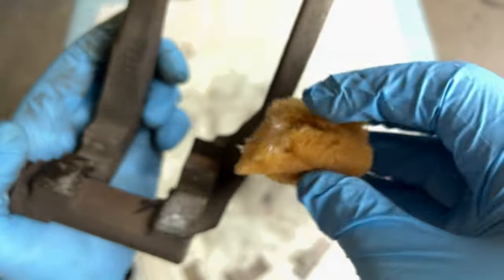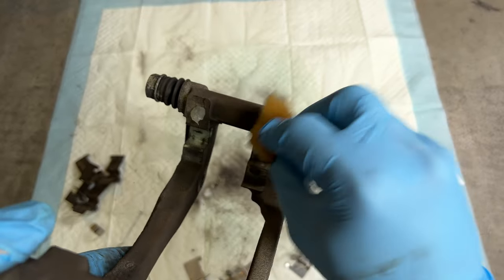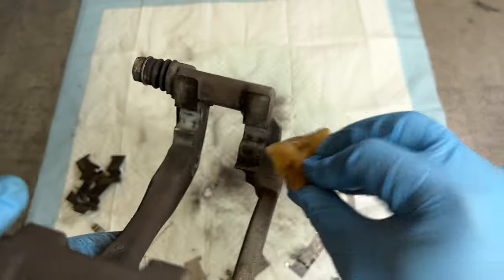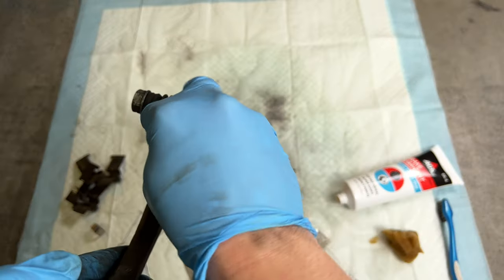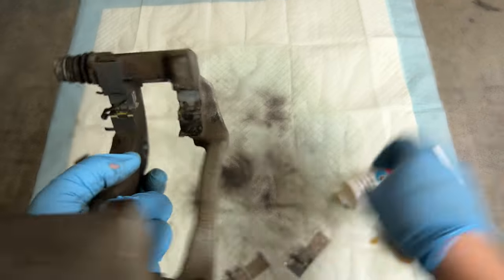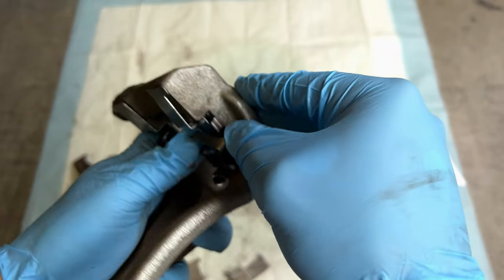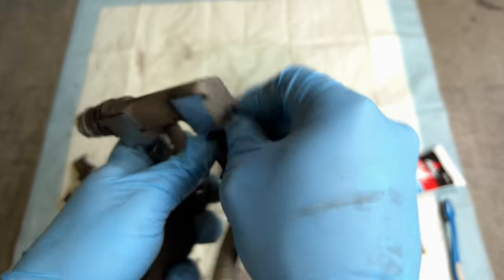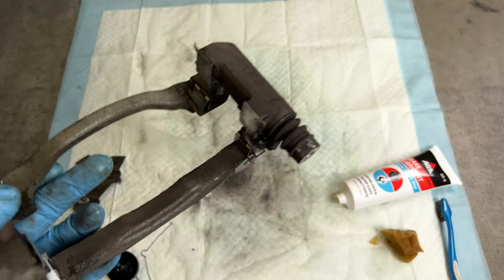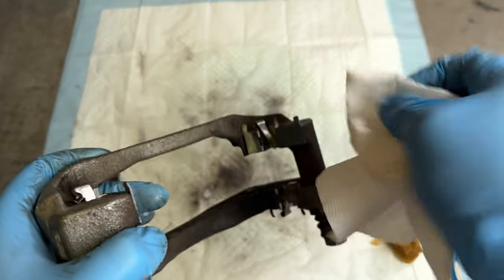It's important that after installing the shims, we clean up and make sure there's no lubricant on the non-mating surfaces. Slide the shim down and into place — notice how the v-shaped piece opens inward to the caliper. Once you have all four installed, clean up the area and move on.